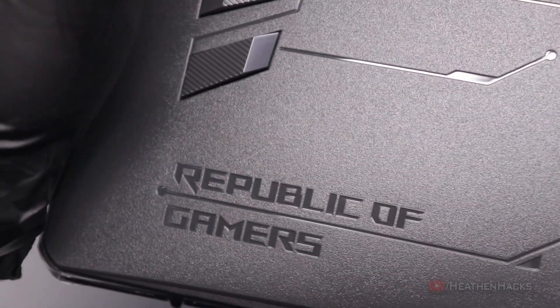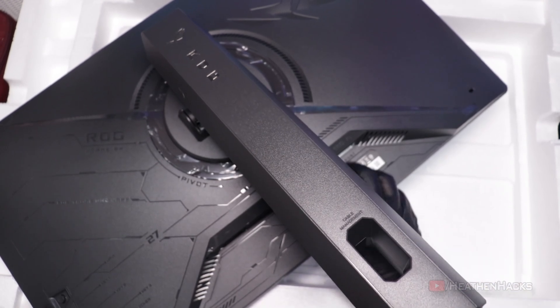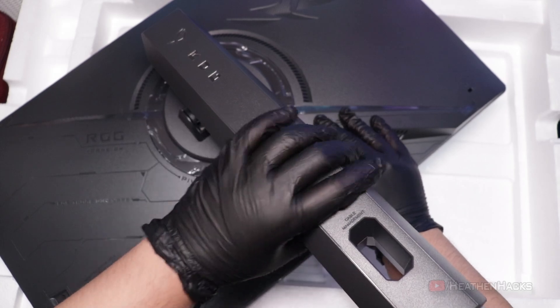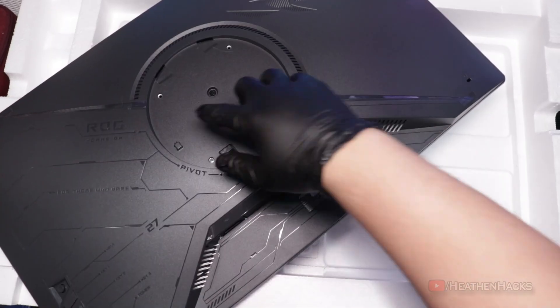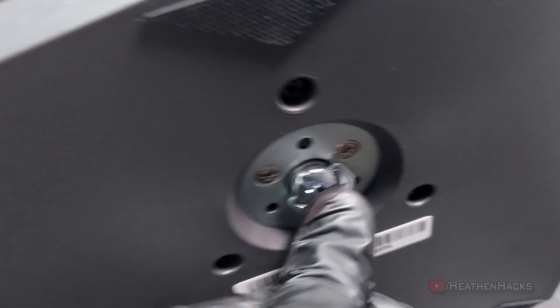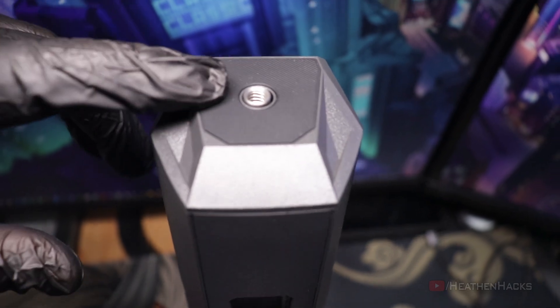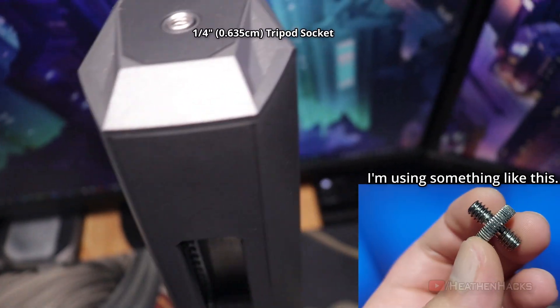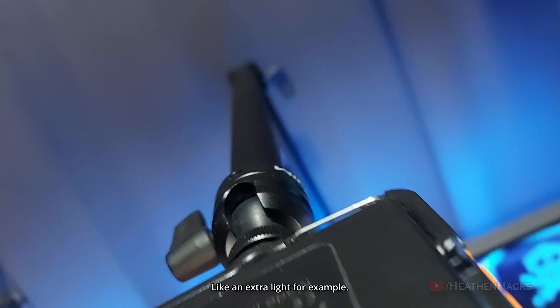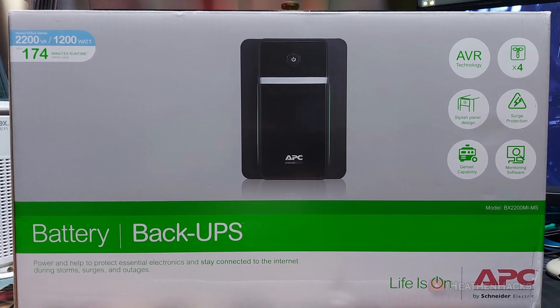Another ROG branding here, and this one right here is for ease of assembly — you just need to hook the stand to the panel and it's already attached. If you want to remove the stand, you just press this quick release button and there you go. Here is the 100mm by 100mm VESA mount. Let's attach the base, tighten it up, and we're good! I almost forgot to mention there's a built-in tripod mount on this monitor stand. It accepts ¼-inch diameter screws, so you can mount pretty much anything on it as long as you have the right screw size and it's not literally heavier than the monitor itself. Now that it's fully assembled, it's time to connect it to the computer. The power cable goes to my UPS, and the DisplayPort cable to my GPU.